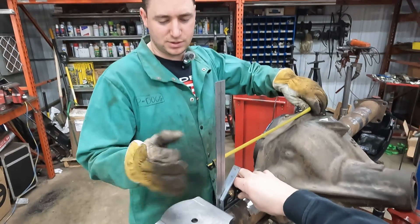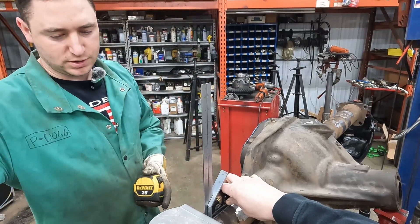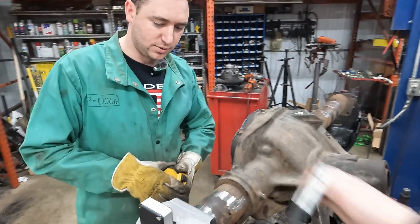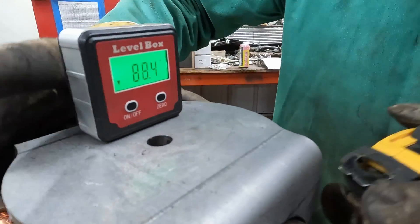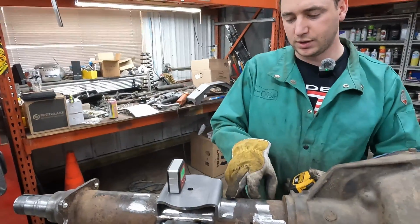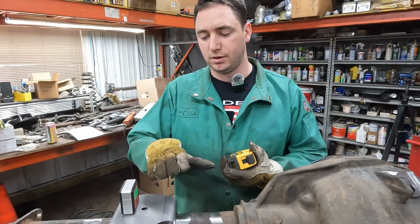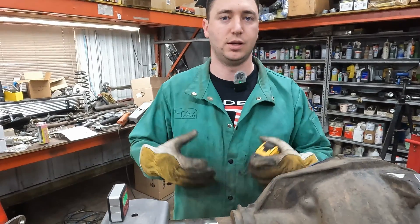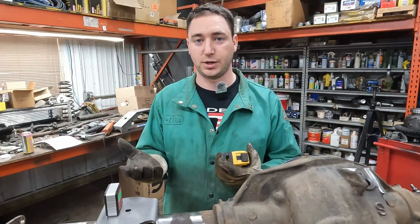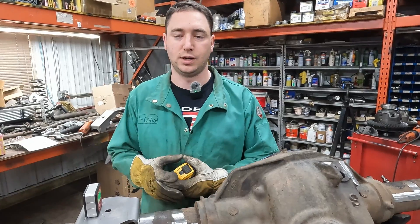16 and 7 eighths to our inside face of our spring bracket. This one you want at zero — it's going to show roughly 90 because we haven't zeroed it out. We'll call that close. When you're going to tack this one on — we'll show you guys in the vehicle later — but this is where you can do some adjusting if you want to adjust your springs. If you tack this in, get it stuffed into the vehicle, and then decide you don't like the angle your spring is sitting at, cut your tack welds, adjust that pad, and weld it in solid.